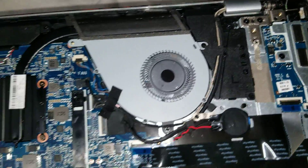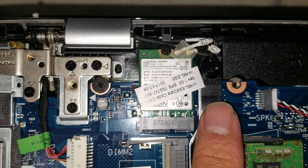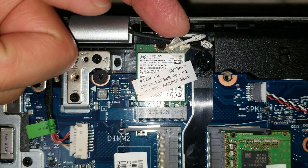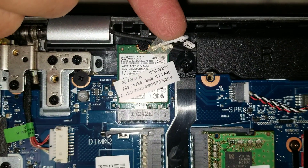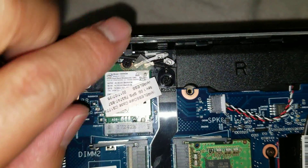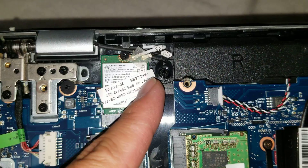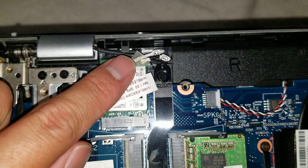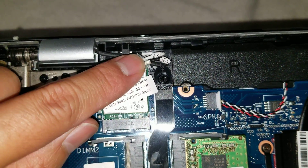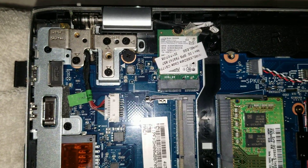I'll do a close-up. I'm not going to take anything out — I did this just to replace the hard drive because their hard drive was bad. You've got the wireless card; they covered it with a little tape. To remove the antennas you'd have to peel this piece off first, and then from the back — the tail — you just pull it up and it'll pop out. Make sure not to pry from the front or you can damage it. When you put it back, line it up, put this part first, then push down and it should snap in. Make sure it's lined up before you press on it because they're pretty fragile.